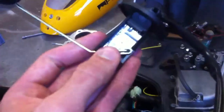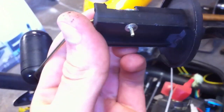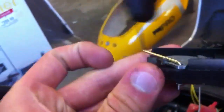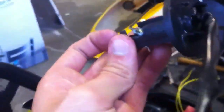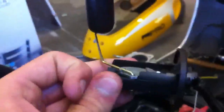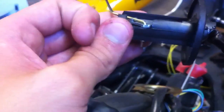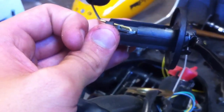What happened on my scooter is on this mechanism right here, there's a pin right there and it was squeezing the bar down too tight, and it wasn't allowing it to move back and forth freely like that. So I just took a pair of pliers and squeezed it up a little bit, and now it's just freely moving. Do not put WD-40 or anything else like that on there, because this is inside your gas tank and you don't want that going through your fuel system or your carburetor. Just loosen that pin just a hair so it can freely move.